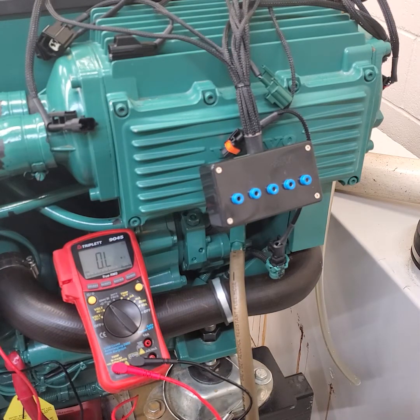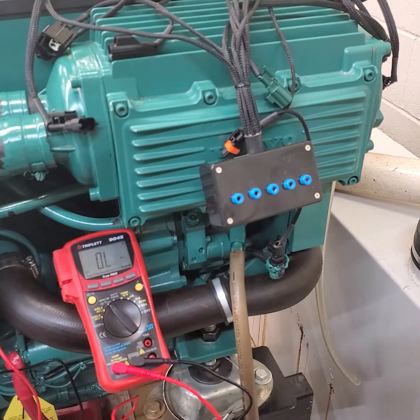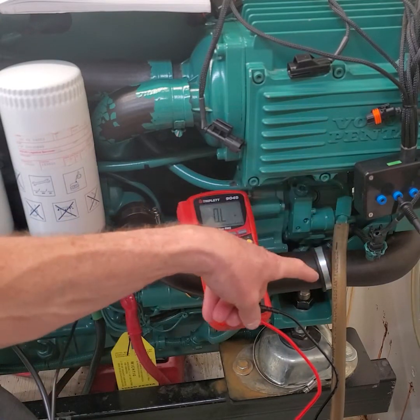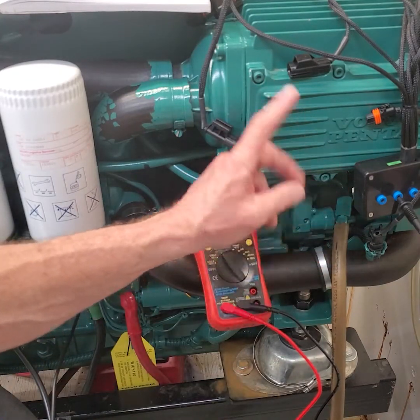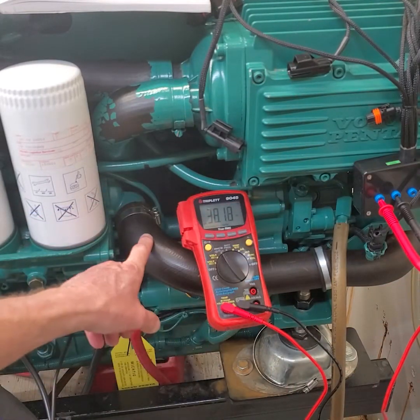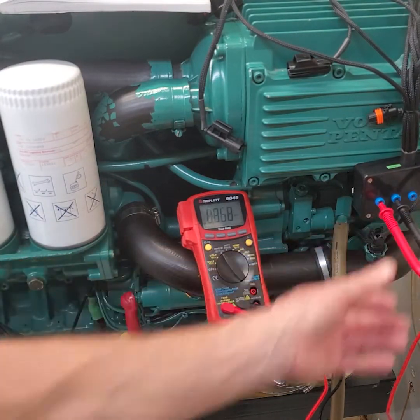The diagnostic routine in the book has a couple of steps. Number one is shut the power off - that means shut the battery switch off. So my signal side through the transistor and the EDC processor, that's the one making the make and break to ground, or it's applying power as a high side driver. I can check for that from ground all the way through that driver circuit through the EDC processor, and that tells me that circuit is in good shape.